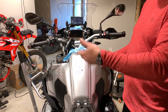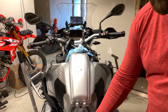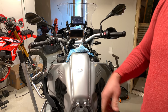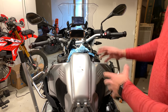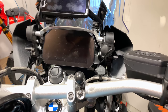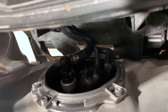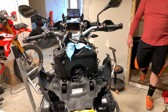I probably should have done this before I put a bunch of fuel in for the winter — should have done the swap first then stored it. You're going to slide the tank back onto a towel; there are a few fuel disconnects on the rear of the tank on the bottom side. Slide it back, do the disconnects — there are actually three of them, they're quick release tabs. Pop those out and get a towel ready in case of fuel leaking.